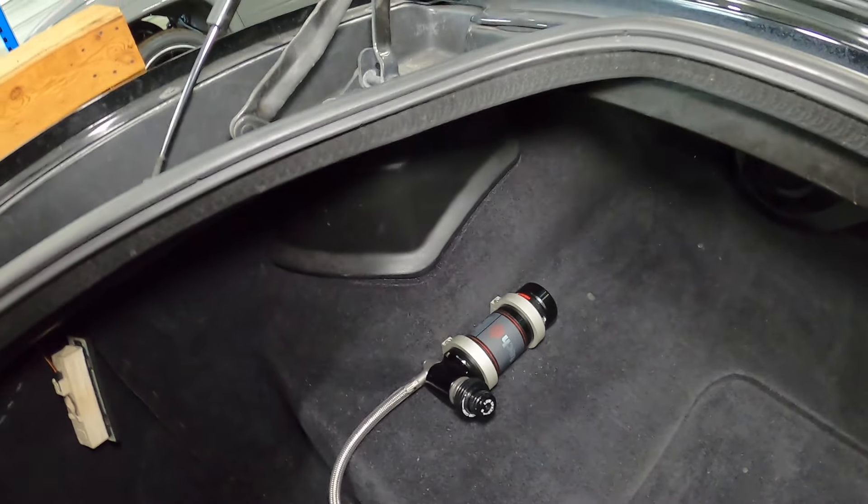The nice thing about this setup: we've got high speed compression — for bigger bumps and dips when the suspension takes a big hit — low speed compression for smaller more insignificant bumps, and rebound which controls how fast the shock returns. It's pretty cool that we can adjust all of that. Not only that, we can also play with the preload on the spring and try different spring rates — it's pretty much infinitely adjustable. If that's all too complex, RideTech does have a simpler upgraded suspension if you're just on the street and want a better handling car. I'll link them below. Go check out the bushing video and the sway bar video as well. Super happy with the setup — can't wait to get to the track. Give it a thumbs up, subscribe, and I'll catch you guys on the next one.